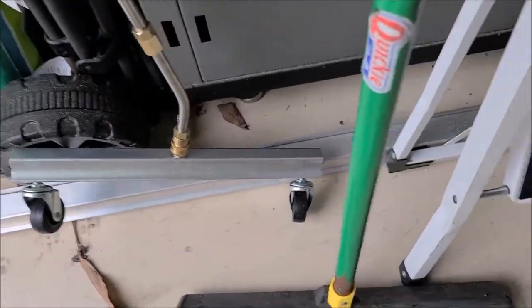The video before this showed you how to clean the undercarriage using the pressure washer broom with an extension — cleaning it without having to get all the way under there. Let it dry — that's important too. This product will push water out of its way, but you don't want it soaking wet when you spray. After cleaning, you can use the pressure washer broom to rinse all the cleaner off, and then let it dry before applying the coating.